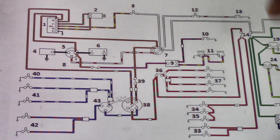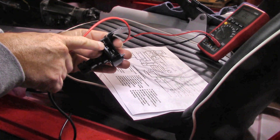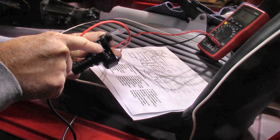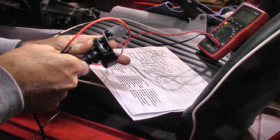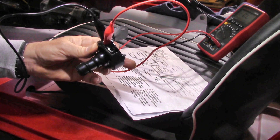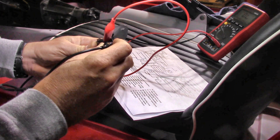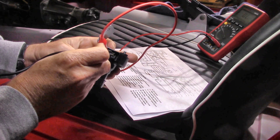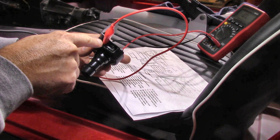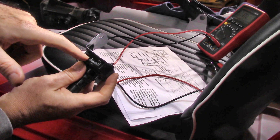Back to the car — here's the foot switch I was talking about. It has three possible connections on the inside with tabs. The center one is the main feed and the ones on either outside go to either the high beam or low beam depending on switch position. I've got my center feed there with the Fluke set up. When I press the switch it makes a short. One way or the other the lights are going to be on when power comes in from the headlight switch and actually turns the headlights on. The center is going to get the solid blue wire.